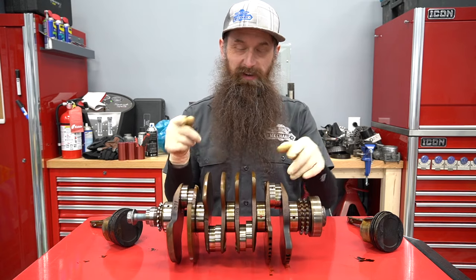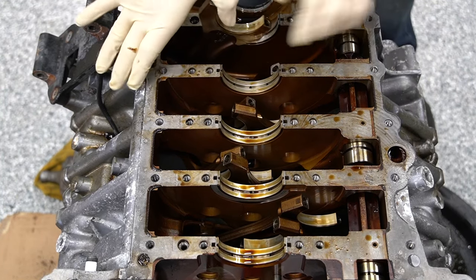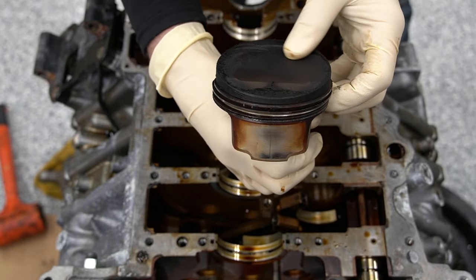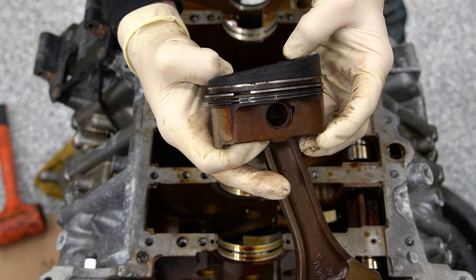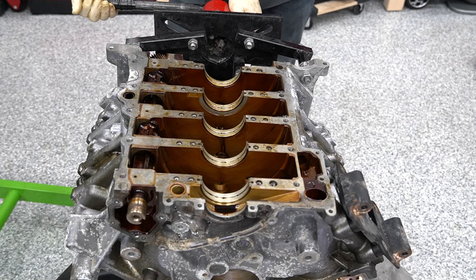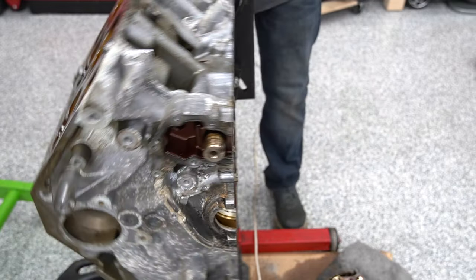What a cool-looking block setup with the pistons and connecting rods kind of folded over each other — really, really neat. This one also has the oil jets that squirt oil to the backside of the piston. Let's go ahead and take a piston out. Here we have our piston, and look at how much carbon is built up on the piston and in the rings. This oil ring is pretty clogged up. Just like all the other VR6s, it's not a flat-top piston — one side sticks up higher than the other. Our block is basically stripped completely down. It's actually a pretty lightweight block — I wish I had a scale to measure it. So that is a W8 engine: two VR4s put in another V, 15 degrees on the VR4 side and then 72 degrees in the center V.